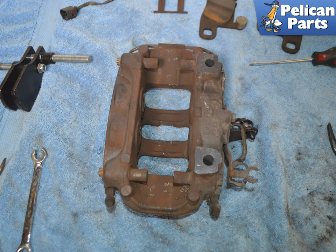Make sure you remove any dust buildup inside of the caliper, and then apply a small amount of anti-squeal to the back of your brake pads. Brake pads must be properly bedded in or broken in. Brake in your pads according to the manufacturer of the type of pads you purchased.